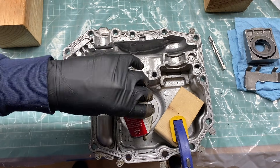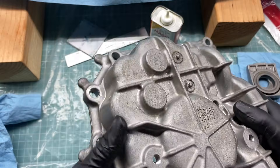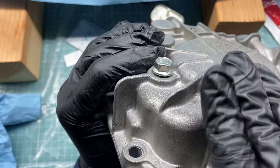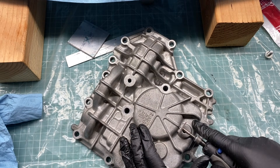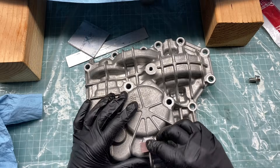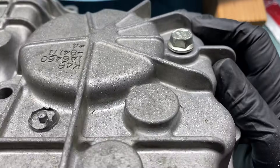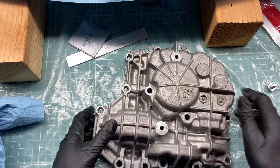Let's drill and tap the other hole. I've noticed there's a little fin that's pretty close to where the drain plug is going to sit. I'm guessing it probably isn't a problem because this is where Tough Torque designs the holes to be, but just to be safe I'm going to shave part of that fin down with my Dremel tool. If you decide to do this, be careful because it's super easy to accidentally take off too much material. I'm going to take a piece of emery cloth and smooth things out. I'm also going to smooth out the surface on the first hole so the drain plug makes better contact with the currently rough surface.